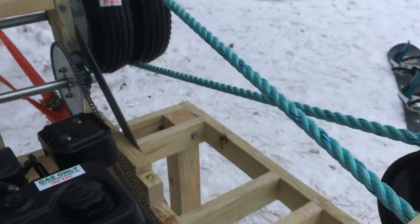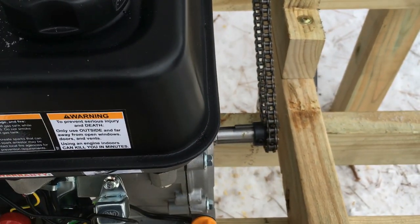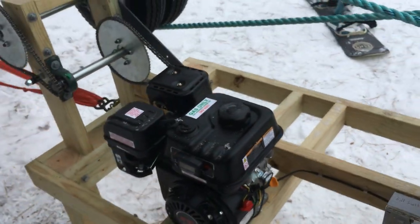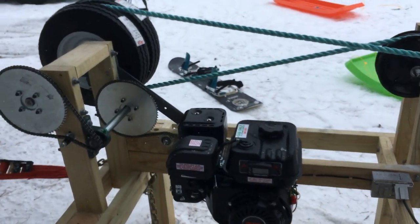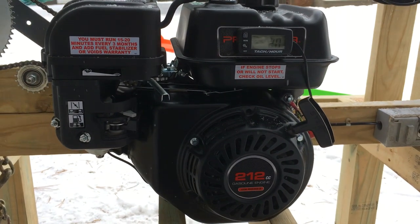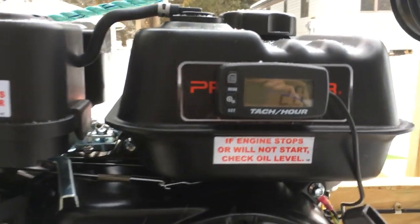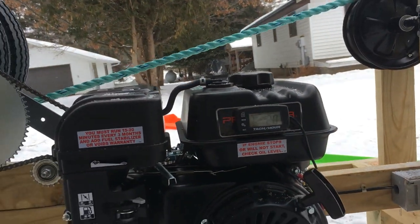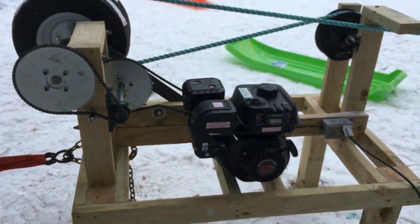On the motor, it's just a straight sprocket. I was going to go with a clutch, but I wasn't sure if it was going to get too hot. The motor is a Predator 212cc, and I've got a little tach on there — about two hours on this thing. It's done really well. The chain tension I had to mess with a little bit, but it starts good.